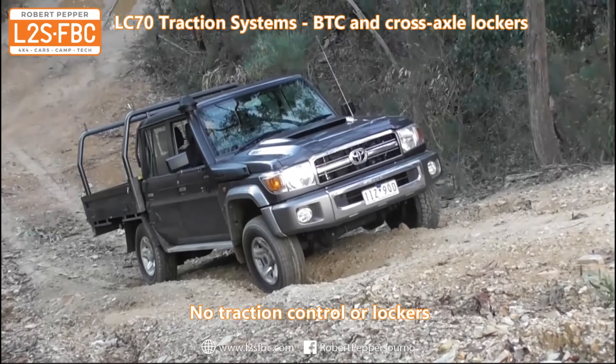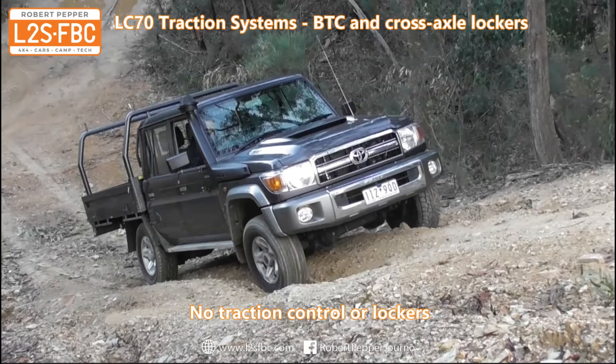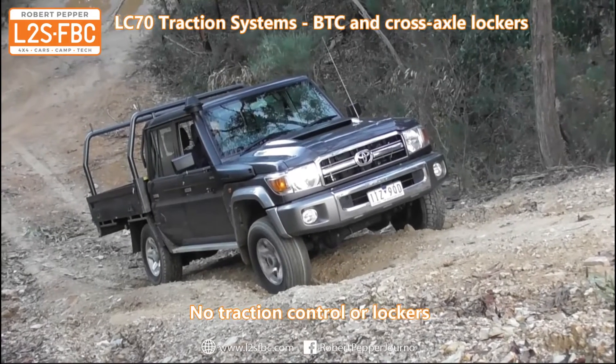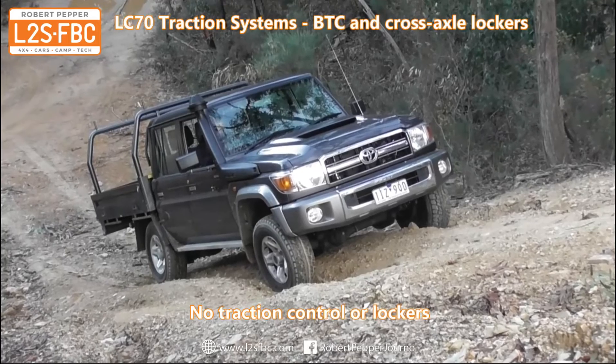What's happening here is that the front differential and the rear are equalizing torque. The left wheel only gets as much torque as it needs to turn the right wheel. So all that is going to happen is that the front right and rear left are just going to continue to spin, and that's as far as the vehicle goes unless we take more momentum. The back left wheel is spinning as well — go back down.